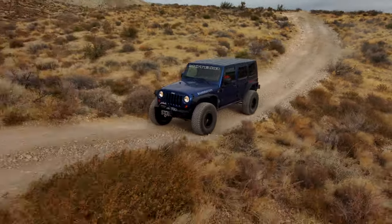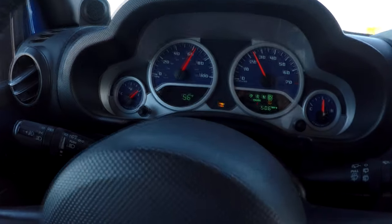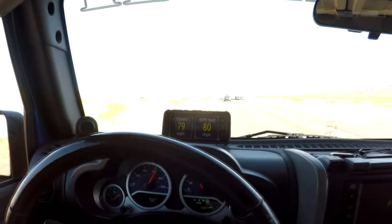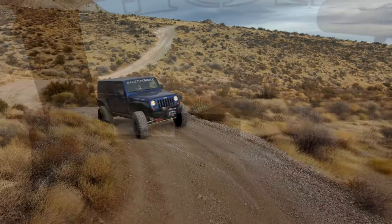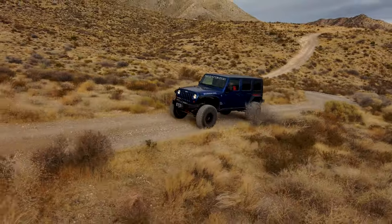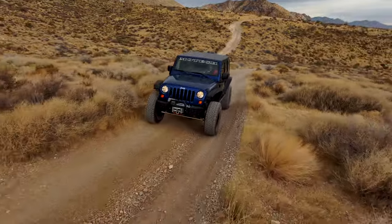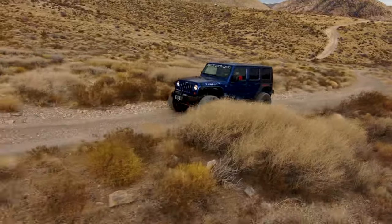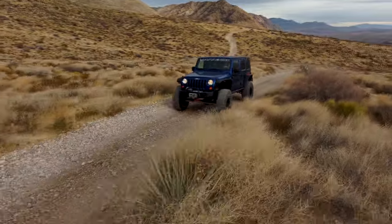But let's talk about the known issues before we go further. One is the speedometer is off. Two, you'll see that sway bar light is flashing. That is an interesting story, because back when I did this Jeep, we really didn't have the adapters available to us that we have today. So we used a 241C, that's a Chevy. It's still a driver's side drop, bolts right in, but it didn't have the transfer case range sensor. I do believe there are some GM transfer cases with a range sensor built in. I don't know if they're compatible with the Chrysler values, but this one didn't have it.